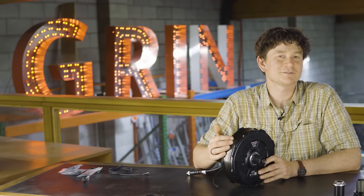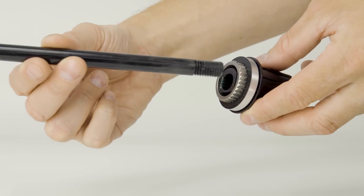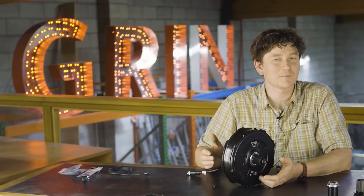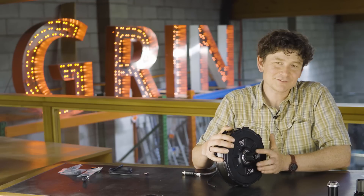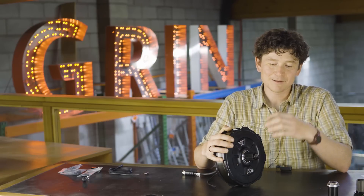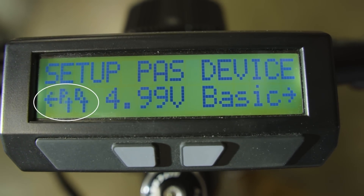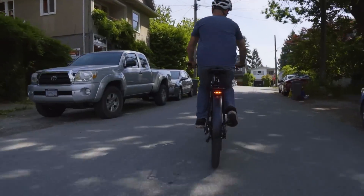In fact, that's part of the reason why the launch of this rear motor has taken so long. Unfortunately, all of the torque sensing cassette freehubs that we were able to source and prototype with were not intrinsically compatible with the larger diameter necessity of a thru-axle hub — they could only work for non-thru-axle systems. So in the absence of a torque sensing option, we did the next best thing and managed to incorporate a high resolution magnet disc on this freehub body so we could add our own PAS sensor built right into the motor. Even though it's a 12-position sensor in the freehub, the rotation of the freehub body is scaled by the gear ratio from your front to rear chainring, which amplifies the resolution — so it behaves on the bike like a 30 to 50 pulse sensor.